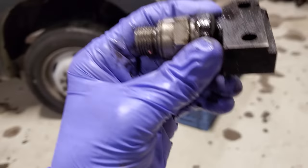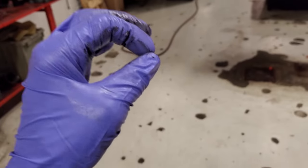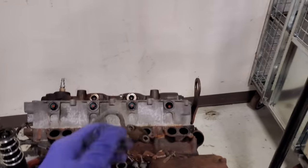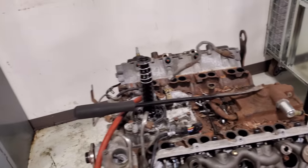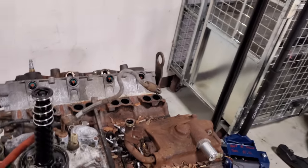The technique I've found useful is a stethoscope. On the aluminum cover with the cast iron Spicer pump, I can hear the gurgling sound right in the corner of the cover — it's a really muffled gurgling sound. When I hear that particular sound right there, I feel confident that I have a leak underneath that high pressure pump cover. I really want this truck quiet, but let's try it anyway with the test.